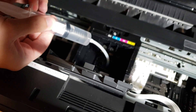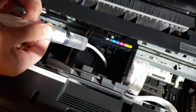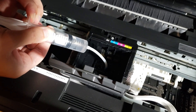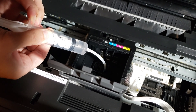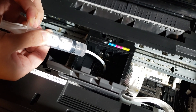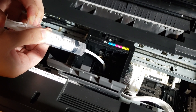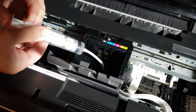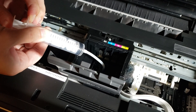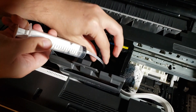The reason this error happens is because the printer head — or at least one of the colors — gets clogged. In my case the cyan color had not been used in a while because I hadn't printed anything with it, and it was almost empty. This causes the color to dry up and clog inside the printer head. So I'm going to repeat the cycle for the cyan color twice until I can feel the resistance going away and the fluid flowing more freely.